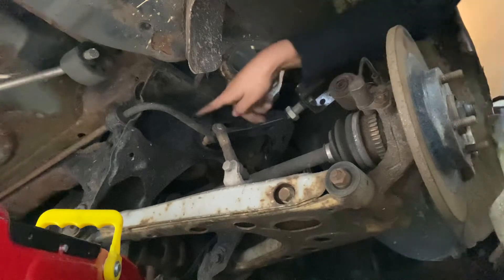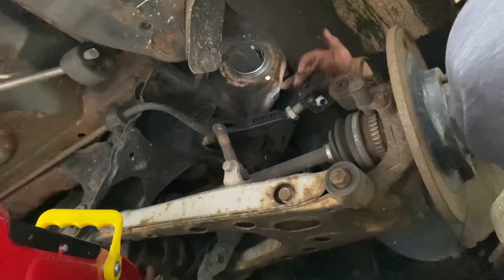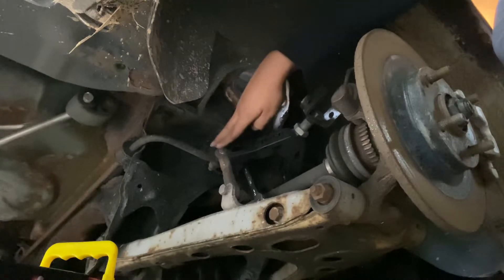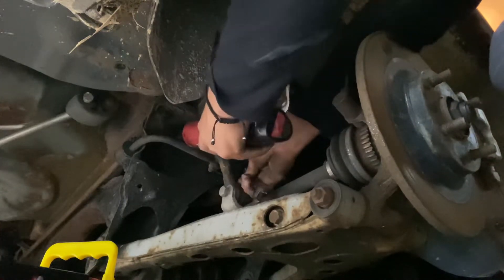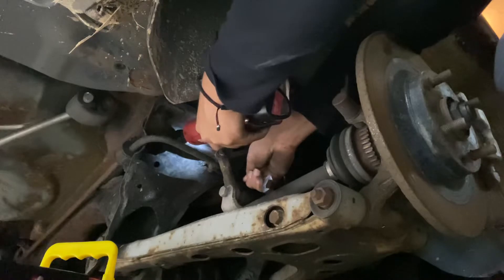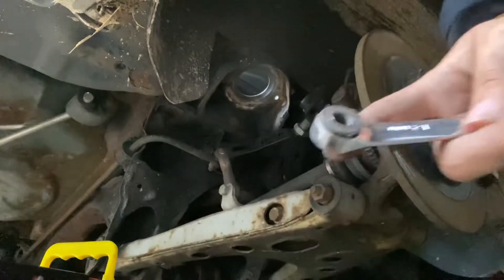Next, I'm doing these guys to get the control arm off. I want this adjustable control arm for the Mazdaspeed. I'm taking off a bolt and nut setup to put up the control arm. I have a wrench on one side and then my Milwaukee impact ratchet.